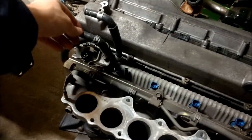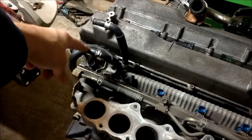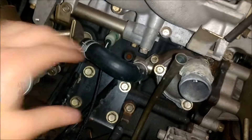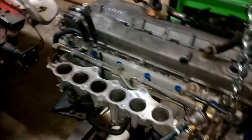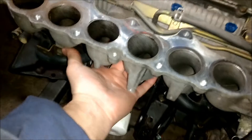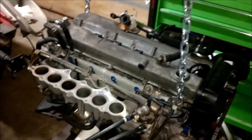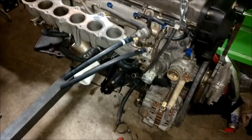I did find where those coolant lines went. There's the inlet that goes into the intake, then one that goes into a radiator that runs across and comes back out, then goes back into the intake, and then down below into another port. Now that I've got that all figured out and know where all the coolant lines go, that will make things tremendously easier. Right now I'm going to run my wiring harness up through here, plug it into everything, and plug in the sub-harness for the coil packs.